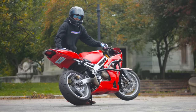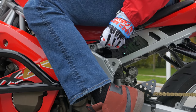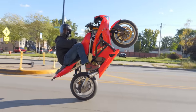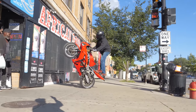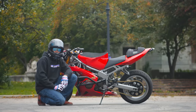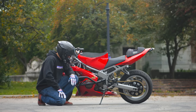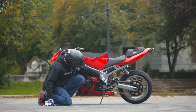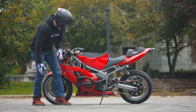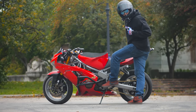I have my idle cable coming out on the left side so I never have to take my hand off the throttle to adjust my idle. I like doing no-handers and circle wheelies, and they all have different idles. I like to run normally right around 3,000 RPM for circle wheelies, 3,500 for no-handers — I'll put this thing up to 9,000 or 10,000 RPMs. Speaking of no-hands, there's a little tech tip: on this side of the cage there's a spot where you hook your foot in, kind of like shift-locking on a dirt bike. My foot hooks right in there, I brace my thigh and entire upper body — that's the key for me to do no-handers.